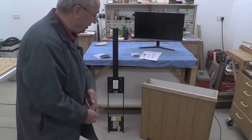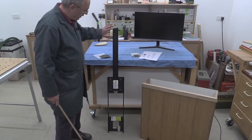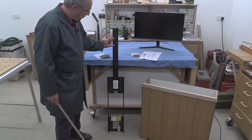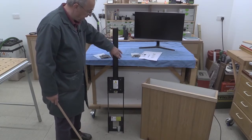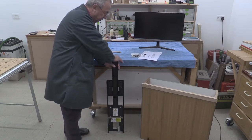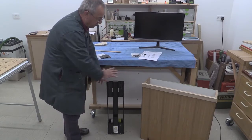The DBLift is a very simple but actually quite sophisticated device. Basically, you have a central portion which can move up and down. It's under spring tension. The monitor would be attached at whatever height suits you on this post. The weight of the monitor may counteract the spring action to an extent, but you would still need to press down to put the monitor away — that would be in its closed position in some sort of cabinet.